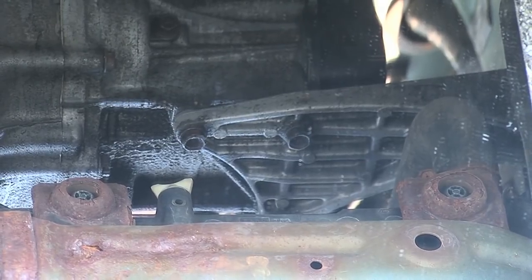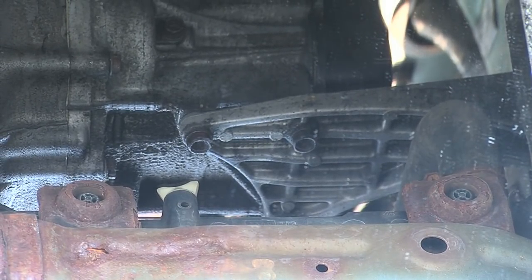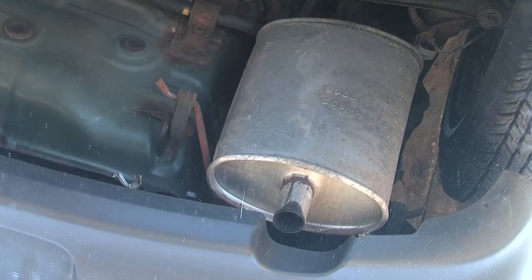Here's an upside-down view of that third mount — the one that connects from the transmission to the driver's side of the vehicle. We're going to keep and reuse that, but as we take the transmission out we'll just need to temporarily remove it. One of the first things we think of in an electric vehicle conversion is that we no longer need the muffler, exhaust pipe, catalytic converter, or any of that hot, rusty, loud stuff on the car.